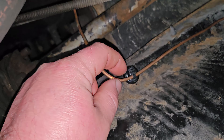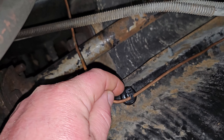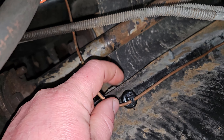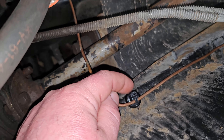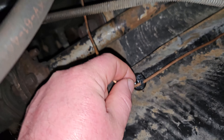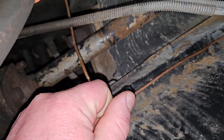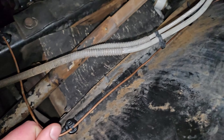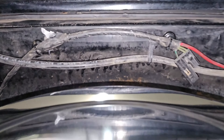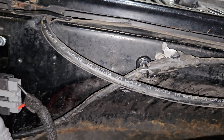These are MagDaddy magnets. They work for anything that's broken on your firewall that used to hold a wire — you can just put this right next to it and zip tie to it. This has a 10-pound pull, supposed to hold 10 pounds. They also have a 15-pound version. They're about two bucks apiece, but the convenience of not having to drill a hole anywhere is fantastic. I've got one on the frame all the way up to here. This one's broken up here, so I added one behind it where the factory one was broken.